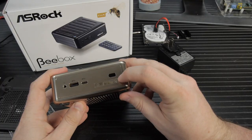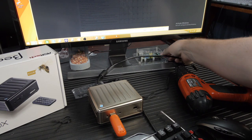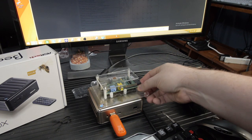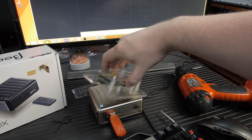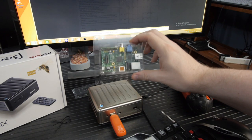I'm happy to report that I installed Ubuntu 15.04 and the Realtek ALC 283 audio, gigabit network, Bluetooth, and wireless AC just worked. I didn't test the infrared remote, but I'd be surprised if it doesn't work, though you may need to set up an LIRC config file. If this platform becomes popular, you'll have no trouble finding multimedia distributions like Kodi or MythBuntu. You could also run OpenELEC, Plex Media Server, or Plex Media Client. Unlike a Raspberry Pi, this runs anything on x86 — Windows or Linux, your choice.